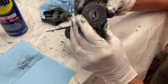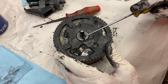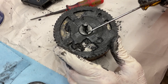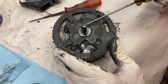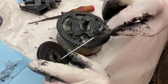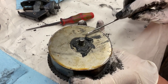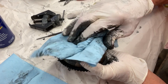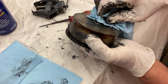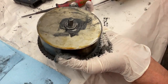There we go — and there is the illustrious pin. Now you take a little punch and knock this out, and then the whole spring barrel comes apart. This fits in here, but I'm not going to knock it out yet because you have to take the end plate off first, then you knock it out. So we'll wipe some of this oily crap off. The reason you want to do this is there should be a little washer right there.